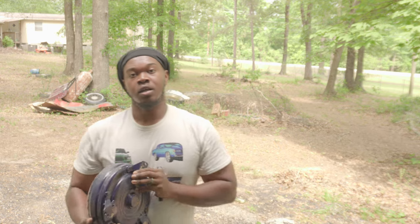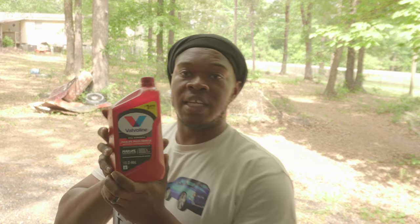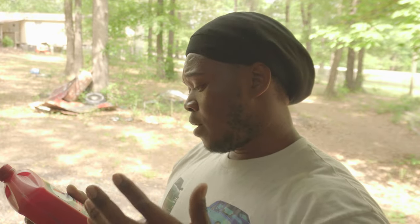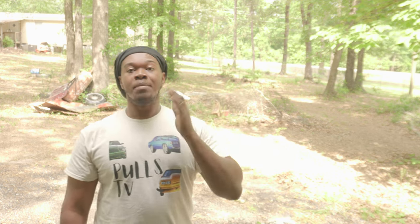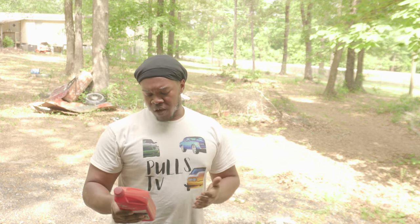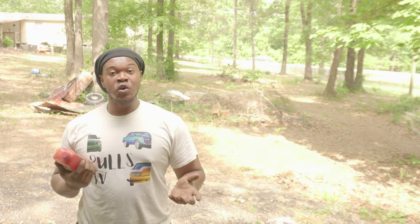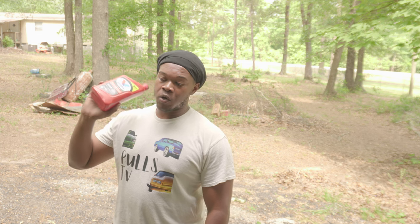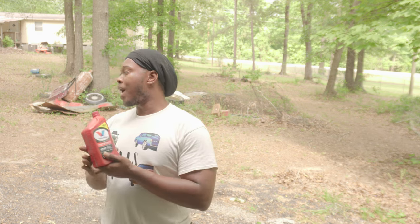In the beginning of the video I brought up about the fluid. I decided to go with the Valvoline Max Life multi-vehicle full synthetic fluid. The other fluid I was thinking about going with was the Type F fluid - people kept saying Type F fluids are supposed to be better, supposed to produce less heat when you have a converter and all that. I kind of got confused, got to a point where I didn't know what to do. So I went with the regular fluid but upper-tier - the Max Life. I just bought one quart for now.